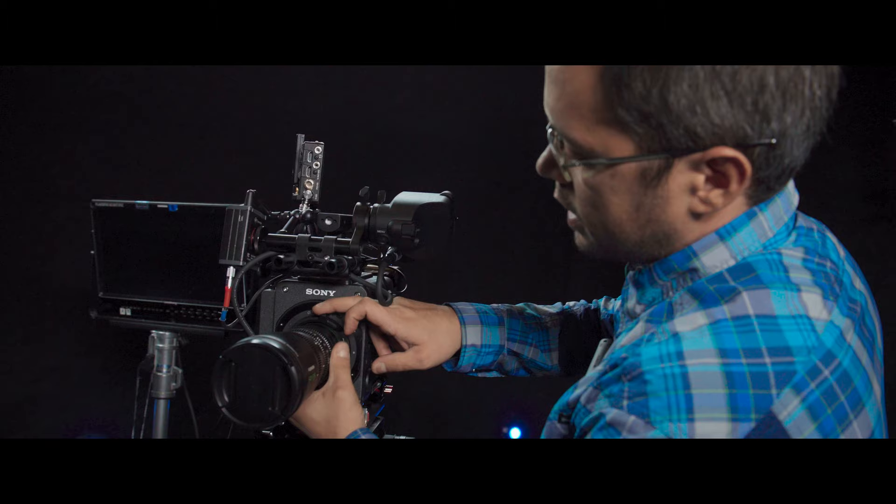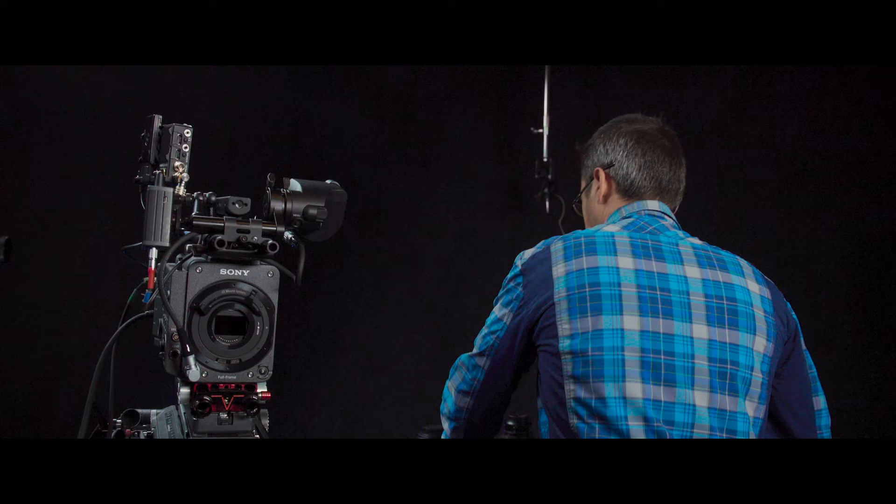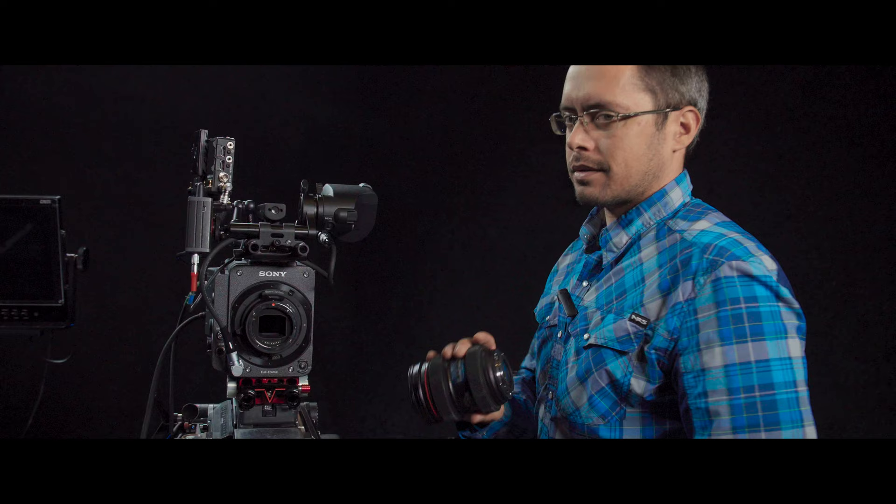Alright, so as you can see, we have this E-mount lens on here. And what's important — that little pin lever here — the reason it's there is when you slide this locking tension lever over, it stops. That way you have to make sure you have your hand on the lens, and then it'll come off. Otherwise, if they didn't have that there, when you rolled it all the way over your lens or your mount would just pop off. So we'll take that off, and then you can take any adapter. This is Sony E-mount to, in this case, EF — Canon's EF mount. But it could be an adapter to anything. Lock this thing in there. Now we're on Canon glass. You might want this for a cool macro lens or something fun, and it's going to work the same.